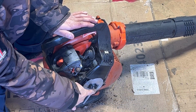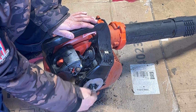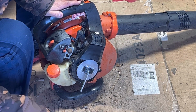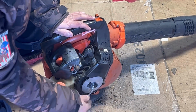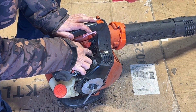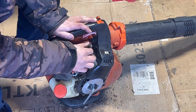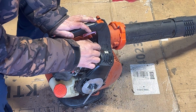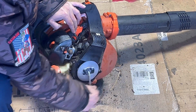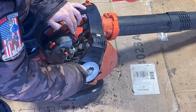So I found an Allen key that fit that hex bolt pattern, and I couldn't turn it, so I had to use a long extension pipe, this copper pipe, and then I blew some more penetrating oil down the spark plug hole. I even helped it by lightly tapping the piston going down while doing that. And look at that.